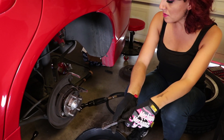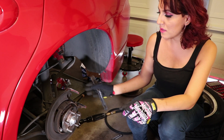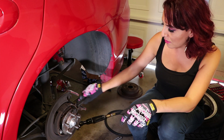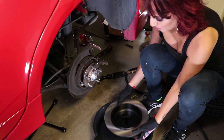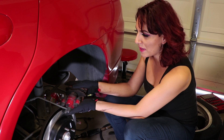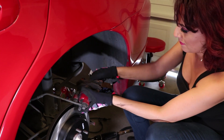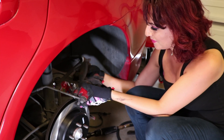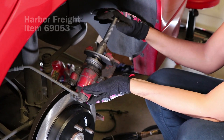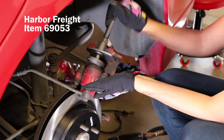Our rotor is now clean. Now that I have access to this area, I want to clean the surfaces so that the brake pads can move freely, because if I don't clean it there's a chance there might be some noise when I put them in. Now I'm going to remove the old brake pads, being very careful with the lines as I remove them. Before I put in my new brake pads, I have to compress the piston. I have a special tool that's going to push it in, and I'm going to turn it until it bottoms out.